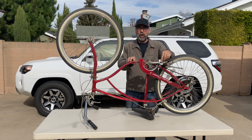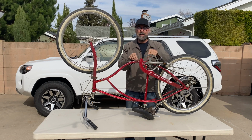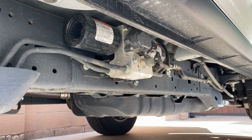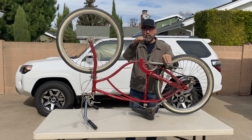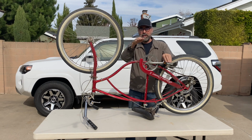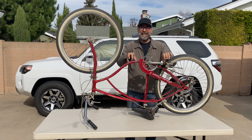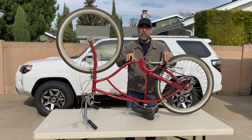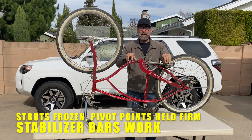And the two pedal arms are the pair of hydraulic lines that run from each of them into a central comparator, which is halfway along the frame rail. So if I'm cornering, left or right, both sides of the vehicle are said to be in phase. In other words, the suspension on both sides is doing the same thing, either compressing or extending. So when you're compressing or extending, the force that's being exerted on the struts is balanced. The fluid can't flow because it basically runs into each other head on and nothing can move.